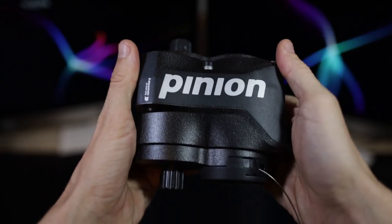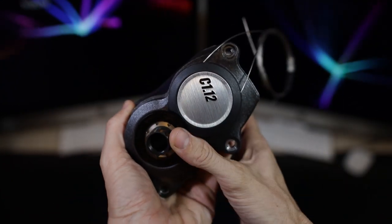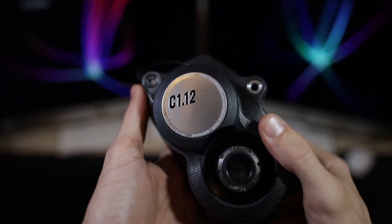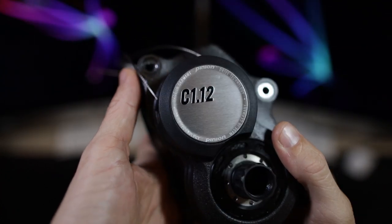Now the weight, the gearbox system is a little bit heavier overall in the drivetrain compared to a cassette. Now the advantage of having all of your weight located inside your gearbox is you can reallocate the weight from your rear wheel and put it in your crank area. Now removing the weight from the rear wheel greatly increases your suspension performance. There's something called sprung versus unsprung mass ratios, which I won't get into too much today, but let's just say the more weight you can remove from your wheel and put into the central drivetrain area down around your cranks, the better.